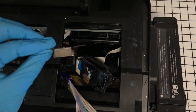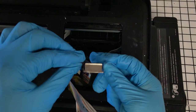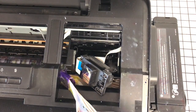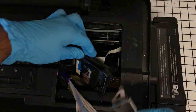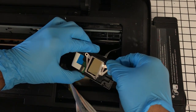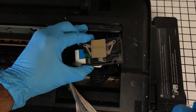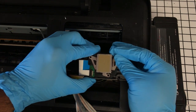So I don't know if you can see that dead on, but just make sure this is fairly level from the start. Once you screw it in, it should be okay, but I don't want this thing being skewed at all. And again, we're just going to make sure we don't scrape anything. So now when the print head makes a pass over, none of that gunk will actually scrape your film, because all of this is a really tight fit.